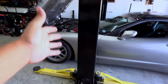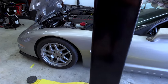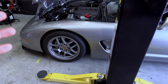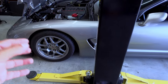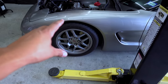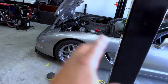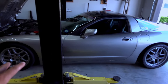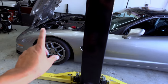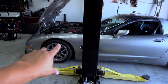But we've reached the capabilities of the brakes. The brakes on this car are at their max — coming into a corner really fast, I have to stop earlier than I'd like because the brakes just can't stop fast enough. I do have track day pads from Power Stop, really great pads, but they've reached their limit. The next step would be to upgrade to C6 Z06 brake calipers front and rear, but the problem is I have to upgrade from 17-inch wheels to 18s on the front because the 17s won't clear the six-piston calipers.